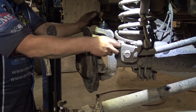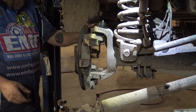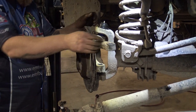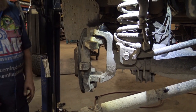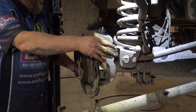And then grab it and make sure it steers. Now, after it's been torqued, it actually steers better than when the install nuts went on. These are so sensitive in geometry that under torqued, over torqued, it's going to affect it. So make sure it's done properly.